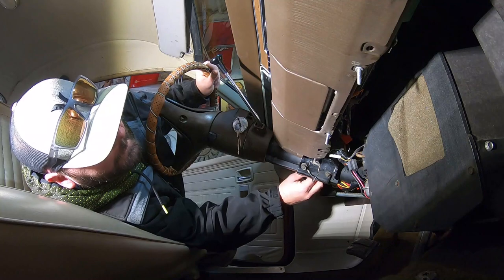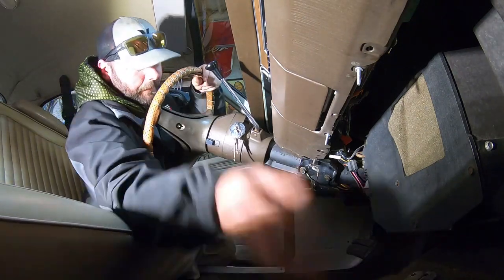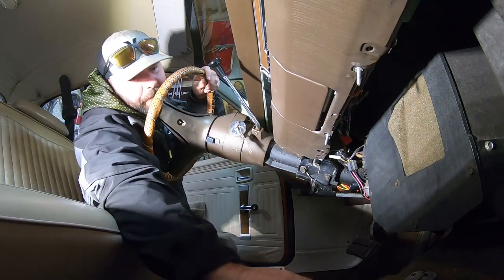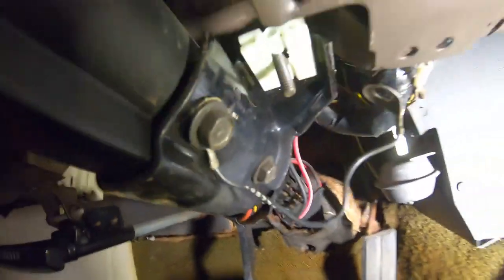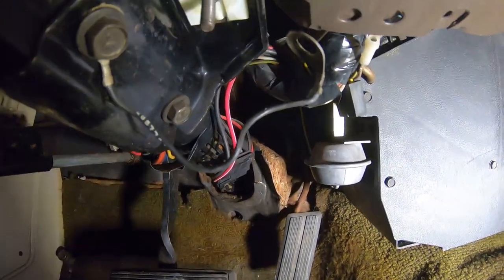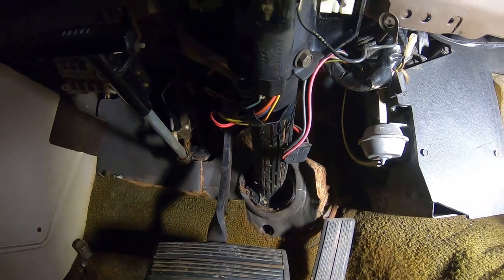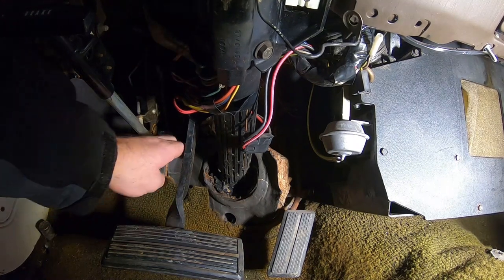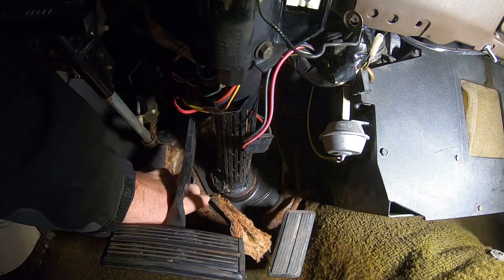Lift up, finger these ones off. Those are off, so now you can get some movement, but we need more movement. We need a 9/16ths now and some light. There are three bolts on the firewall for the steering column, and I need to back those all the way out. They are securely, nicely placed behind this insulation. Those are not 9/16ths - that's half inch.